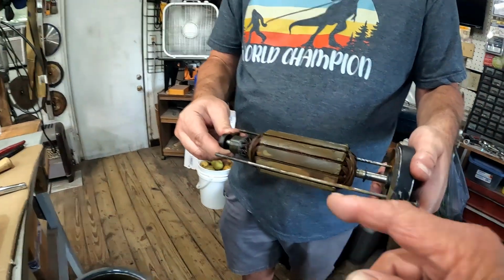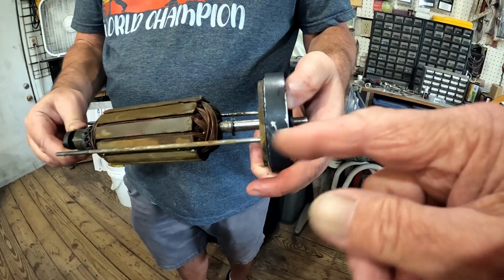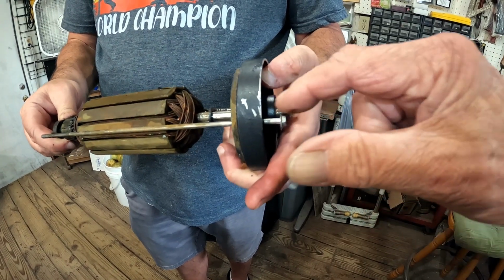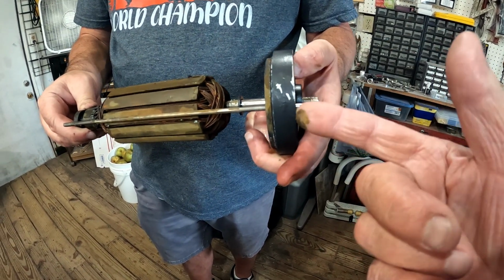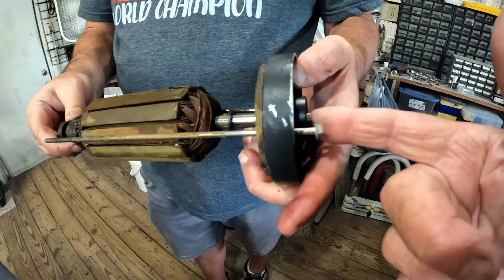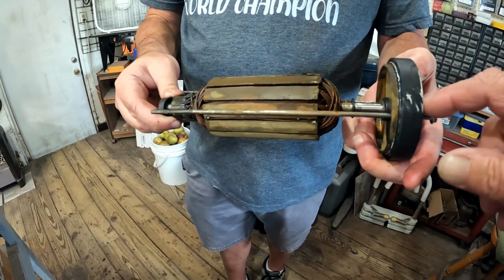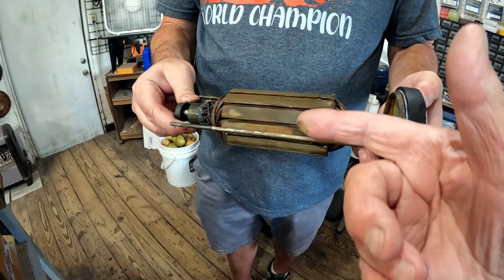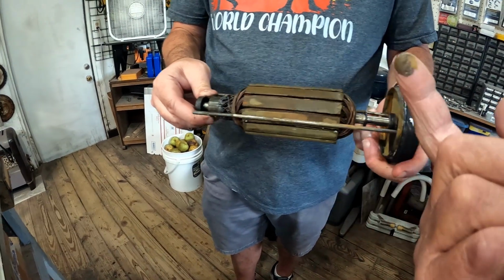Now, we noticed in that kit that Ken got, this has been worked on before. And these bolts here, there's supposed to be O-ring seals in there. And of course there's one on the shaft here. And there were none, there are no O-rings there. So over time that water has leaked in there, caused that mess right there.